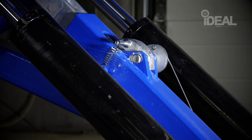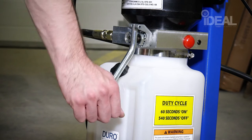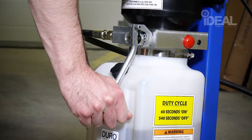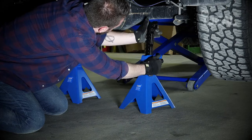If you need to engage the safety lock assembly so that it clicks into the next lowest lock position, press down on the power unit pressure relief valve handle without squeezing the lock release lever. The lift will slightly lower to engage the next lowest lock position on the ladder notches, and install the safety jack stands under the vehicle.